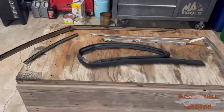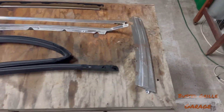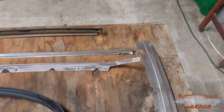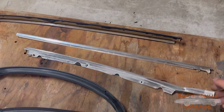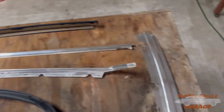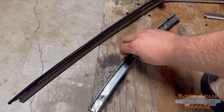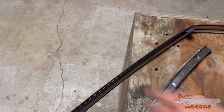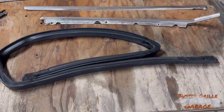So we come over here and we have all of these pieces here, and these do have to come back together in a pretty specific order. So our chrome moldings that show are going to be the first things we have to put on. It goes A-pillar, our drip rail cover, and then our B-pillar molding here. And then from there, we'll install our channel for the weather stripping on the drip rail, the A-pillar, and the B-pillar, and then from there we can go into attaching our weather stripping.